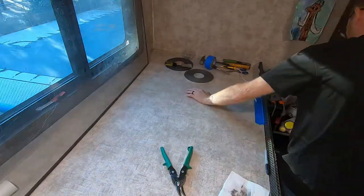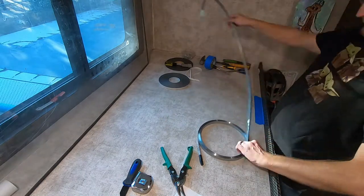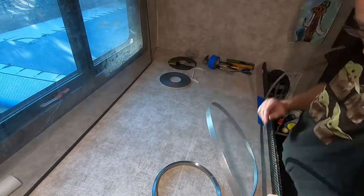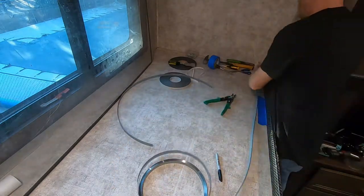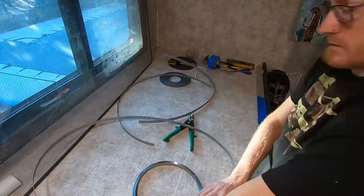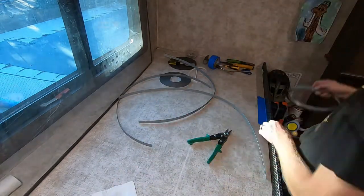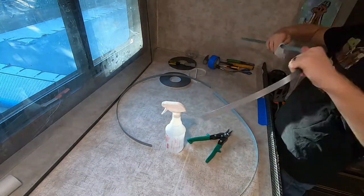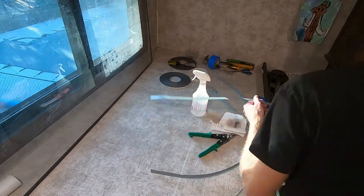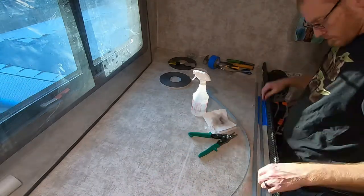The next step is to actually cut the metal strips that will mount to the window frames. Surprisingly, this wasn't very sharp — I didn't feel like I was risking getting cut without gloves. I cut four-foot sections, three of them for my four-by-two-foot windows, and then one of those ended up getting cut to length for the vertical pieces. There's a lot of manufacturing oils on here, so a thorough cleaning with an alcohol wipe is necessary, and then I did my best to straighten and flatten these strips.